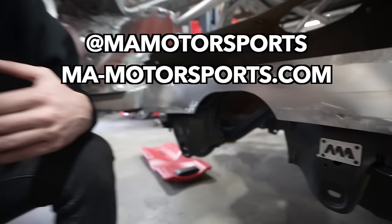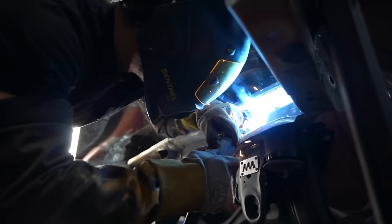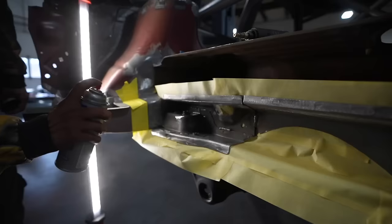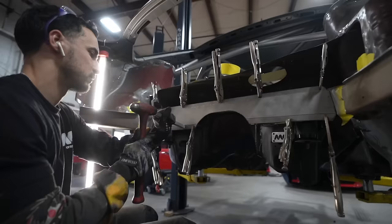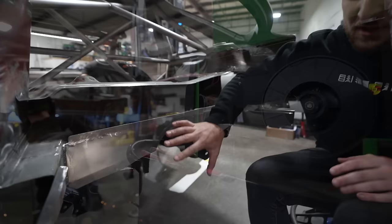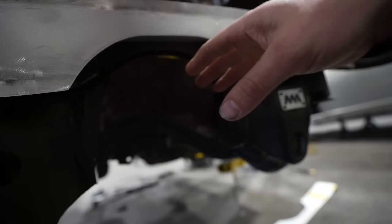Before we could bolt the diff into the car, since it's so large we had to do some major modifications, which Spoon handled just the other day. With the factory body panel removed, Spoon prepped the inside to clean up all the rough edges. Then he stitch-welded all the existing metal in there because the factory spot welds aren't that strong. We had to get the metal prepped, cleaned, and sealed with some Steel-It so there's no rusting on the inside. Then we had to make a new rear body panel to go over that — with a bunch of clamps and plug welds, Spoon welded it up to look just like factory. It's sealed up beautifully, supported, and notched for the rear ends.